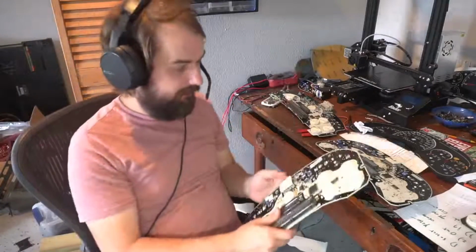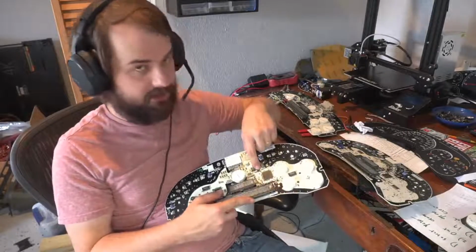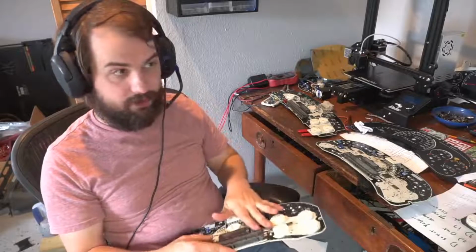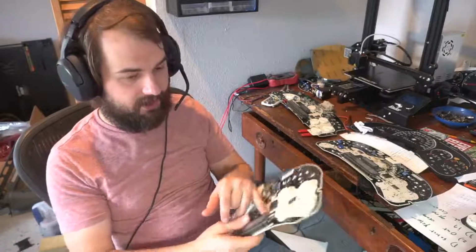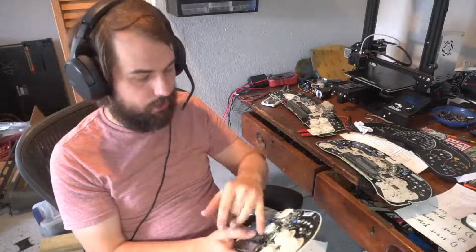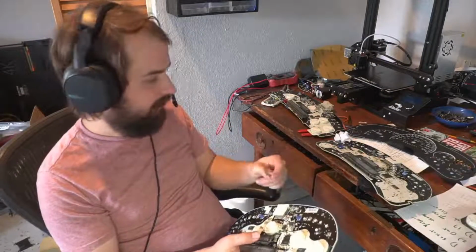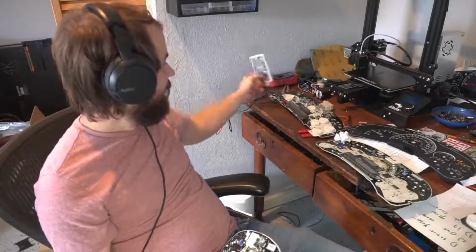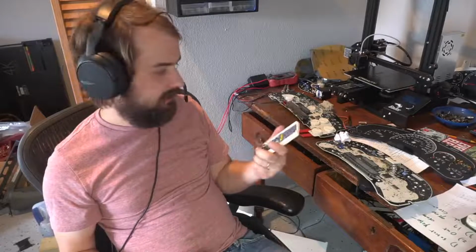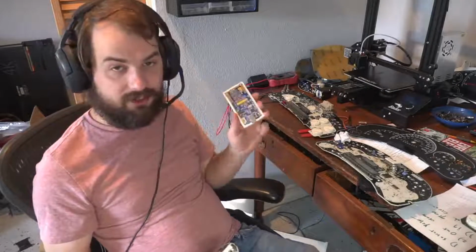And don't worry, I haven't forgotten about the 2005 to 2007 boards. This one's a 2005. You can tell by it having a VFD, but having the voltage regulator, which is a different microcontroller. That is the Infineon 21002558. This one has a C166V2 core in here. So these support JTAG. You need a special JTAG tool called a mini wiggler, made by Infineon, that should be able to program it, but I haven't made that kind of progress with it at all. These U-Links also should be able to do it, but you need a special license with them, and I'm not going to pay the thousands of dollars for that license, so this is junk, I guess.